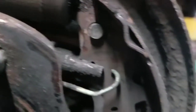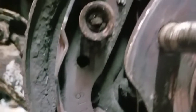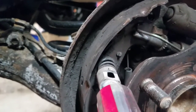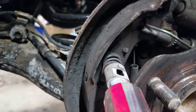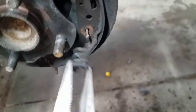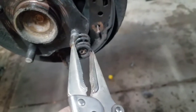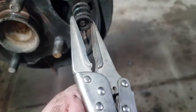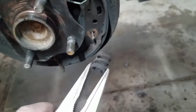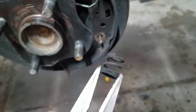The top spring is released — popped out of that hole, and the bottom spring released too. Next are these retainers. There's a tool for that — pretty easy, just press and turn. Sometimes you have to put a lot of pressure on them. For this one it was actually easier to use the vice grip to get the spring clip off — clip it on, push, and turn. When they get really rusty the spring tool doesn't grip as well as the vice grip.